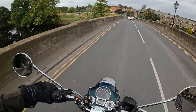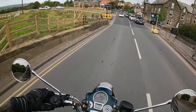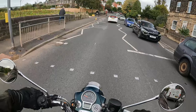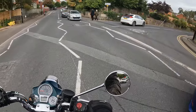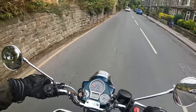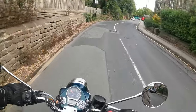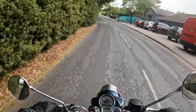Back in the day I was taught and encouraged, when learning to ride, to apply both brakes and get a feel for the balance between front and rear. You have to get back into that school of thinking with these Royal Enfields. On other bikes with much more efficient front braking systems, I very rarely use the rear brake. But with these, the rear brake is a very good brake — I'd go so far as to say the rear brake is better than the front. Your optimum braking comes from applying both brakes in a measured and balanced way, which you do get a feel for eventually.